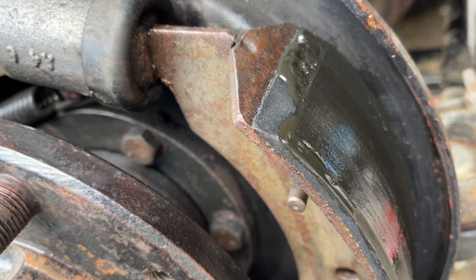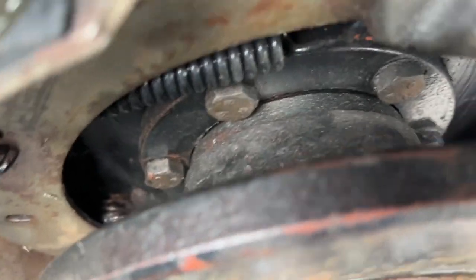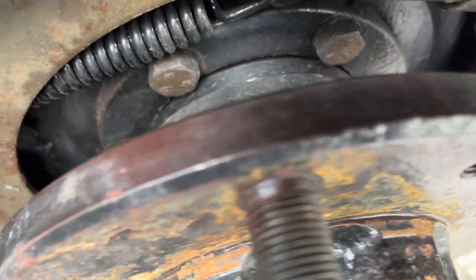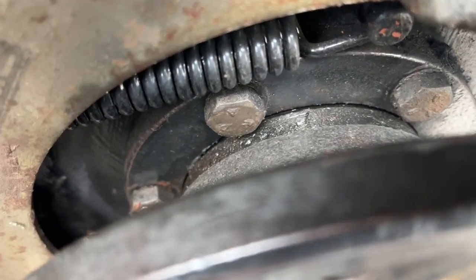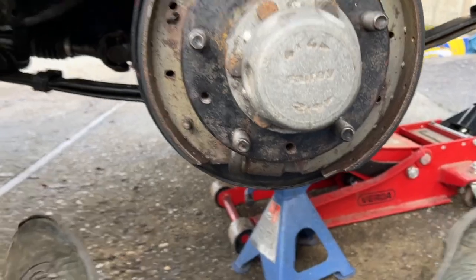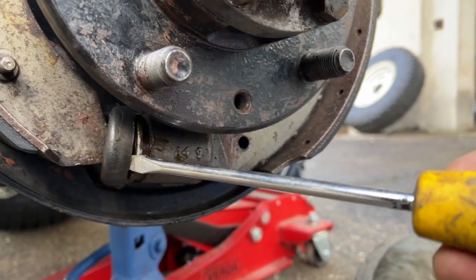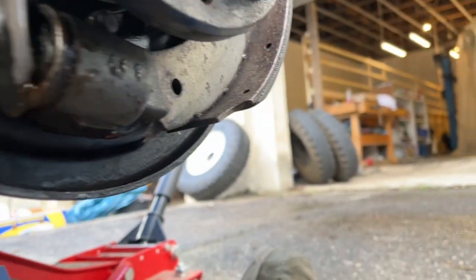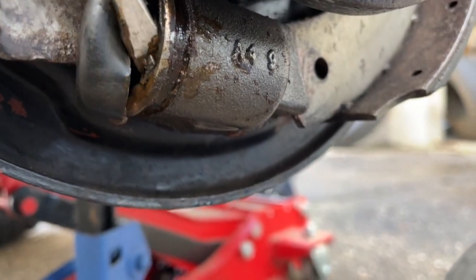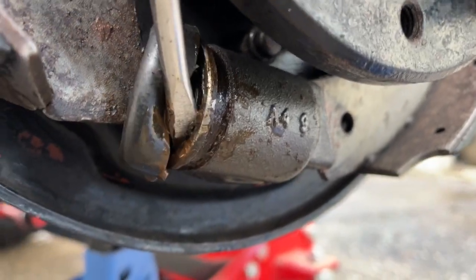As you can see, it's grease — presumably coming from down in there. There's nothing obvious, it's really weird. It's got to be coming from down in there. Looks like I'm going to have to take that apart. Okay guys, I think I just found my culprit — it's just the same as what happened on the back brake cylinder. That is dripping in there, look at that. That is my problem. So it's not an oil leak, it's a brake line leak.